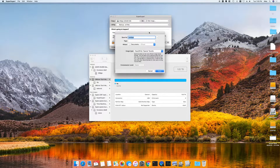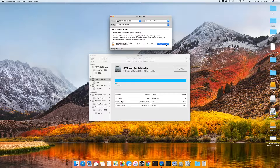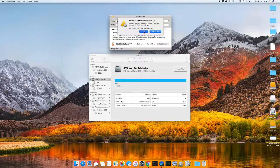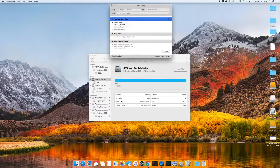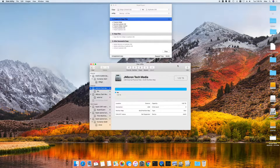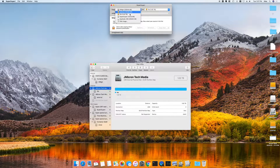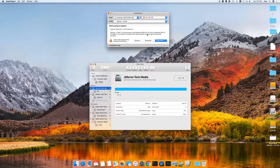You can just clone direct disk to disk. I've got two different external drives connected, and I've also got my failing A-Data as the primary. What I'm going to do is create an image of my main drive as a backup — call it duplicate. Then with that image, I'm going to keep a copy of it, but also take that image and restore it to a one terabyte drive set up externally through USB. I'll have a backup image on one disk, and then my new primary bootable one terabyte SSD. That is the lay of the land.